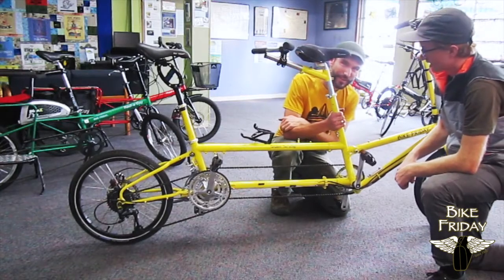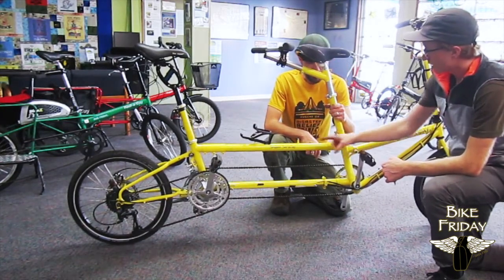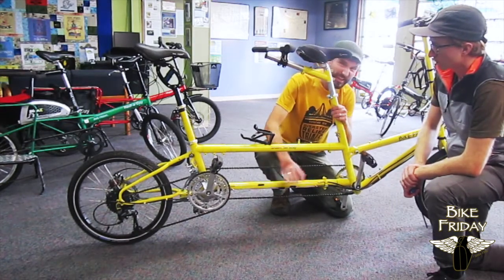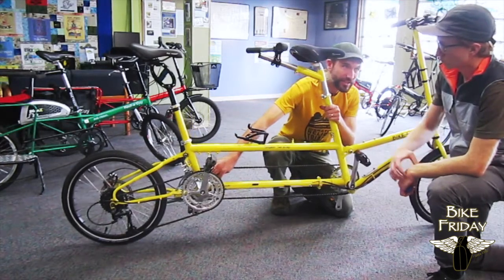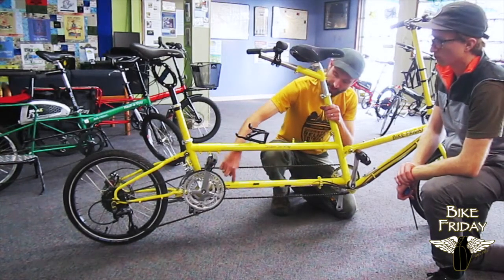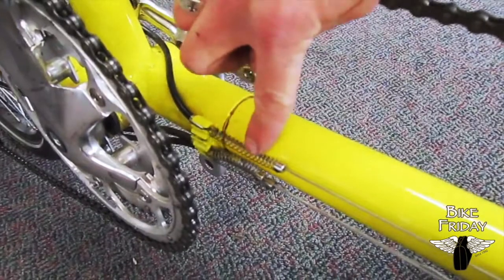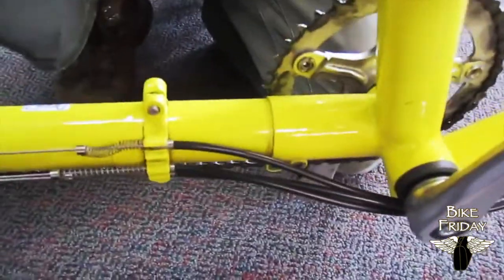So that's the basics — that's how it should work. For some clarifying points: the tubes on the bottom and the top should be fully butted into place. That's why I said originally, if we're starting off with a bike that's working well, this will do it. But if the shifting or braking is out of whack, usually the situation is that the other end — the end we did not adjust — is not fully inserted into that socket. If I'm looking at a run of exposed cable that bridges over where this tube inserts into that tube, I always want to make sure that this mid tube is inserted as far as possible into the socket of the rear section of the bike. We can see the exposed cable bridges over between the mid tube and the socket of the rear section, and we don't ever want to move that when we're tensioning the chain.